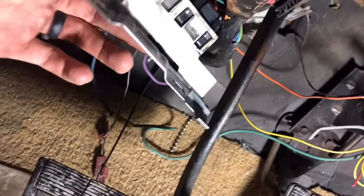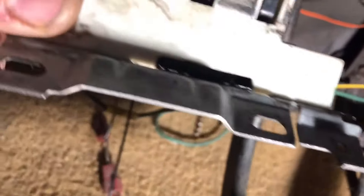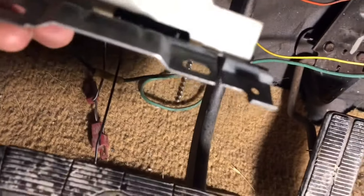Now this is the switch that your key activates. All you're gonna do is pull it down — super easy — take off the two little bolts that hold it on, take it down, and you're gonna see a slot right here. This is the slot. On this side there's a hole; stick your screwdriver in there and slide it side to side and you'll figure the rest out, pretty easy.